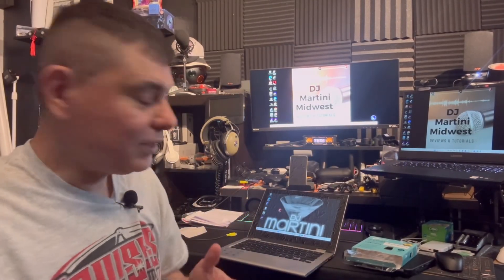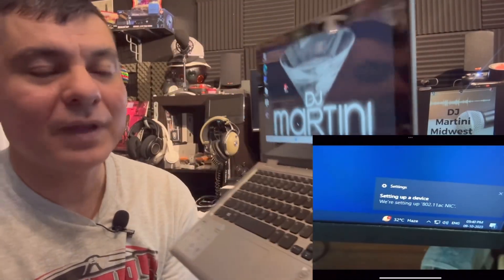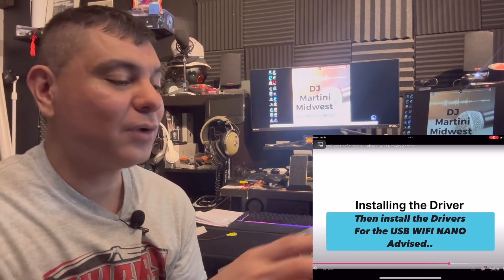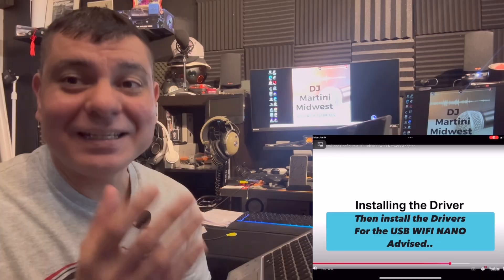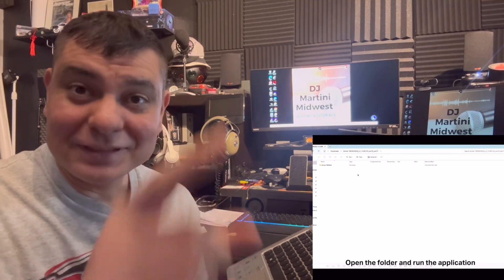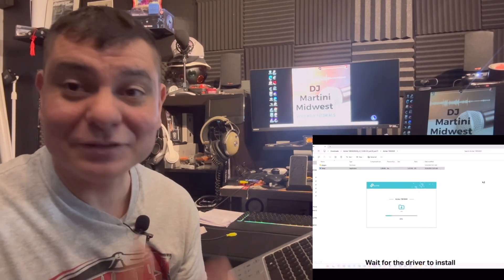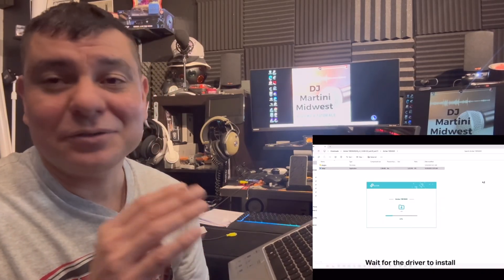Once you plug this into a USB slot in your laptop — and I'm going to show a little side clip so you guys can take a look — it's going to turn green, showing that it's working. Once it gets an internet connection it will prompt and install. You'll see on the prompt it'll say 'setting up device,' and you want to go ahead and install that driver. Once you install the driver it'll say finished. If Windows asks you about it not being trusted, go ahead and run it anyway.